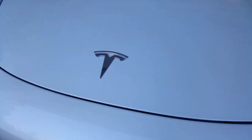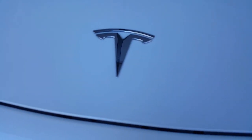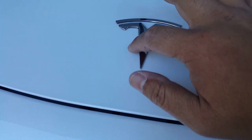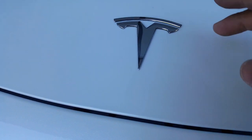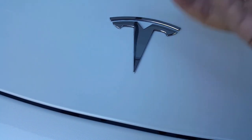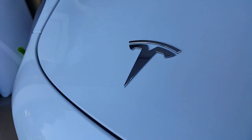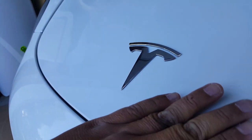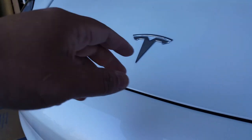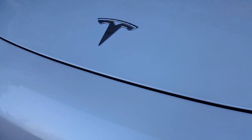You know, a good PPF place will actually lift up your emblem. They won't just cut a little pad in here, especially on white. You definitely don't want to get PPF where the amateurs don't know how to actually take off the emblem. A good shop can take off the emblem, put clean PPF, and then apply a brand new emblem if needed, or reuse it and put adhesive on it again. You can see they did a great job. Everything's rolled in. I'm just really happy.